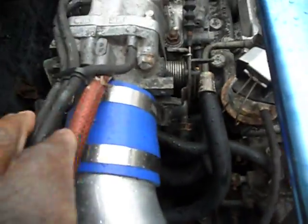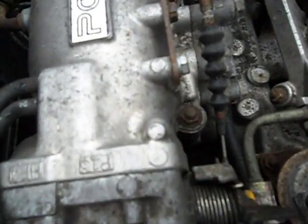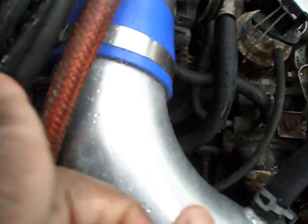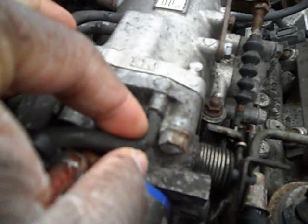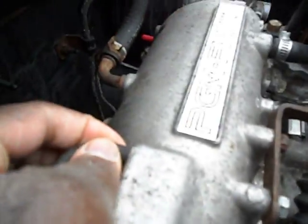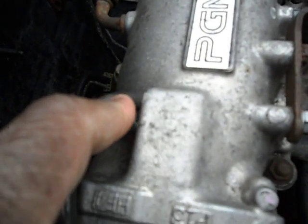So that way you know how to do your vacuum setup, alright? This is a P13. That's what it says right here — it's casting P13 on it. Recap: 21 vacuum line goes here, alright? 20 goes back here, alright? And you have 24 that goes right next to 20.